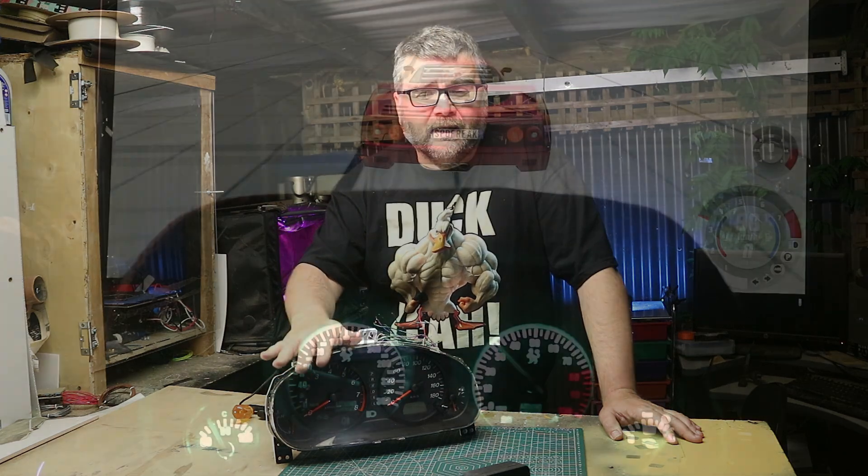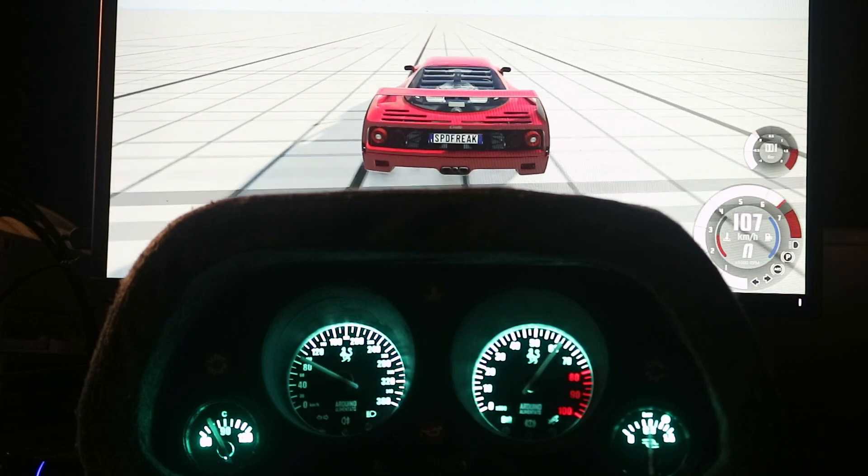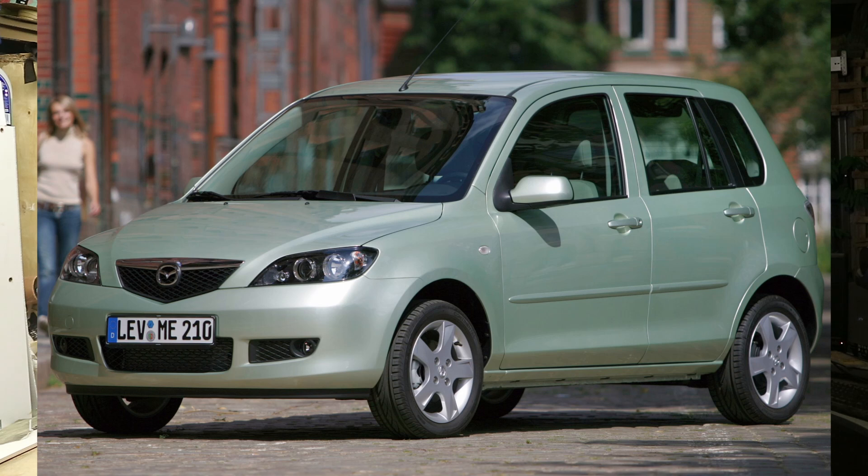This video should cover anything in a modern car. That's why we'd be interested in getting CANBUS up and running — because we can go down to the wreckers and get something like this dashboard and hook it up to our game, and all the dials and everything will move in unison with what's happening in the game. If you're thinking of doing this, don't do what I did and get the cheapest dash you could find on your local classified site and hope it's going to work. This is from a Mazda 2 and there's not a lot of information about it. So before you go and buy your dash, do a bit of research online to see if you can at least get a wiring diagram to get you started.